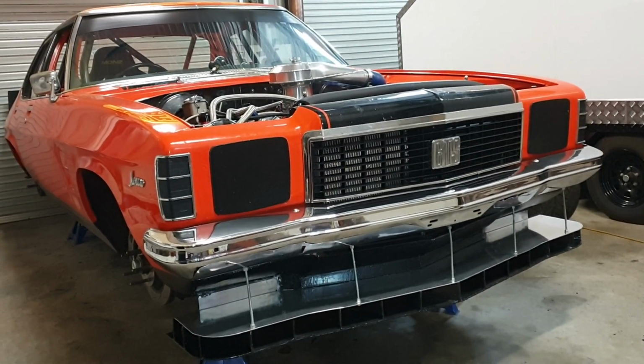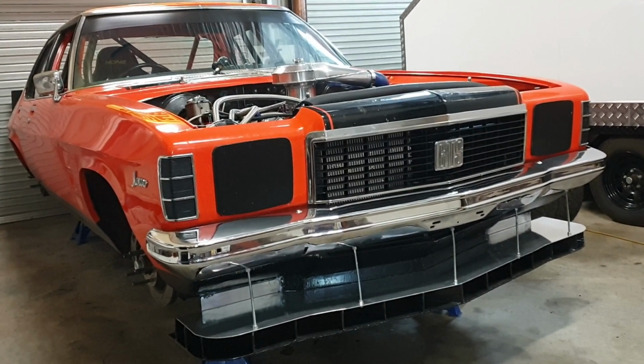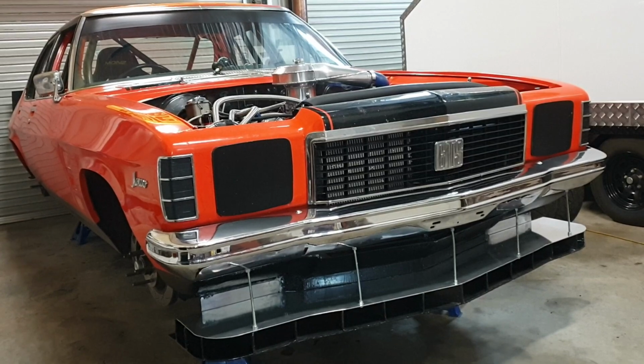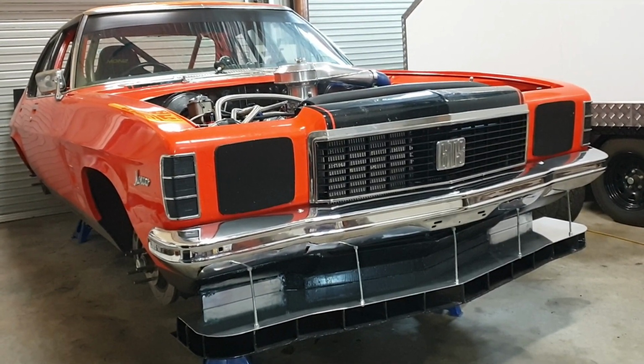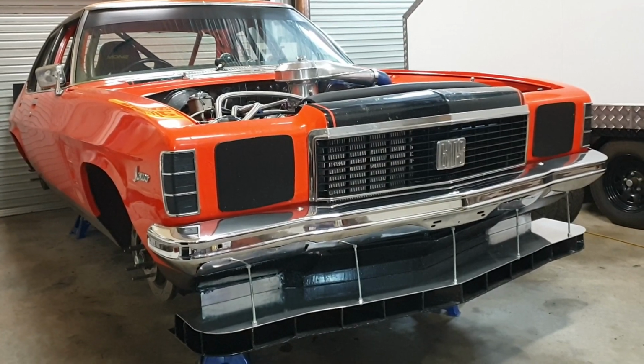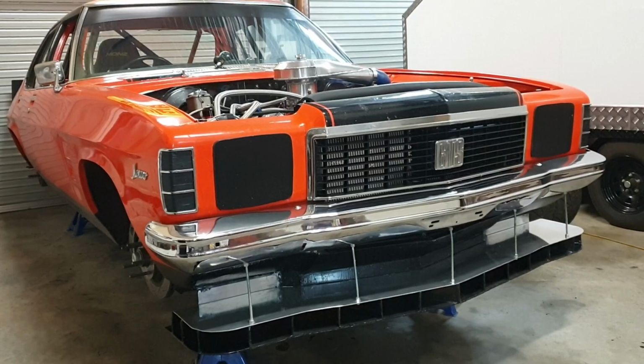Anyways, I went out the first lap. They call it observation laps. It was just a bit of a test around the track for, I don't know, 8 or 10 laps, whatever. And I noticed it was still a bit fuely on the tip-in, and even on boost it sort of got a bit fuelly.